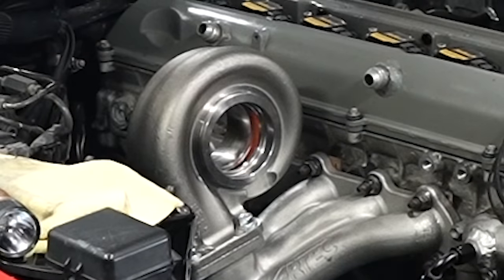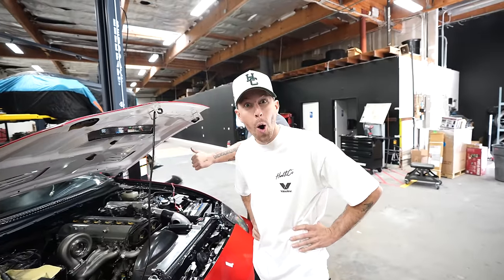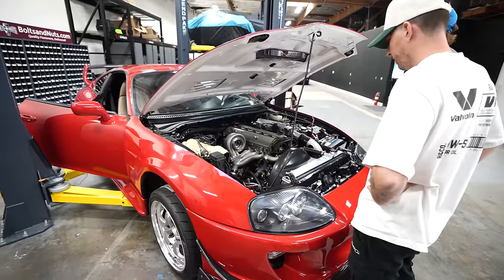We're getting there. I'm downloading the data log off the ECU of the first start attempt, and I'm gonna go over it and see if I can see anything. It sounds like the ignition's not happening at the right time. That's where I'm gonna look first. I'm gonna just double check that all the sensors are reading correctly, all our temperatures and pressures are right. Then I dig a little deeper. Whoa! Whoa. Very cool, I like that.